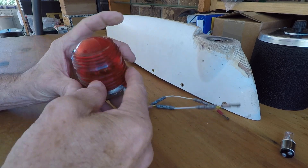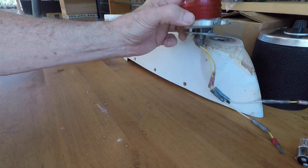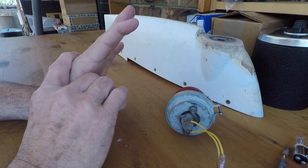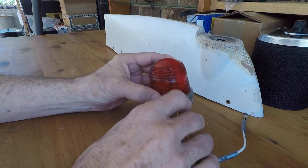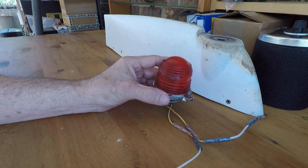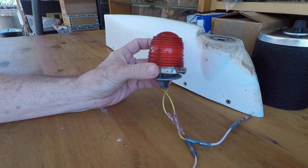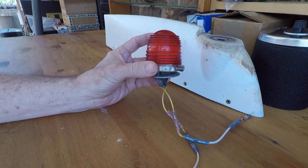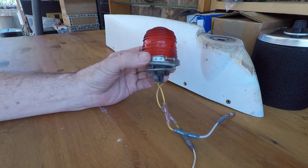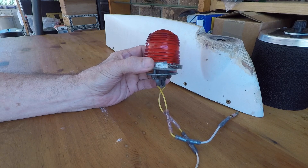It's a lot easier here in the studio than on a real airplane, but that's your assembly of the jelly jar. It sits up on the top, and these wires go to the flasher which drives it — again, it's a 10-amp circuit that draws almost 11 amps. This is the entire assembly sans the bulb. This is how you put your jelly jar together for your Grumman, on any of the airplanes up through the AG5B. It doesn't apply to the Cougar, but it applies to all the two and four-place Grummans. We hope you found this useful — thank you for watching Grumman Pilots YouTube channel and have a good day flying your Grumman.